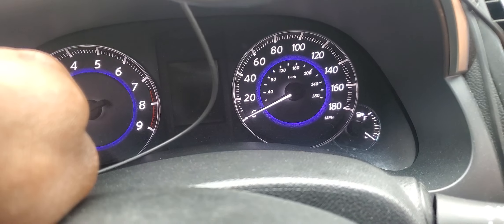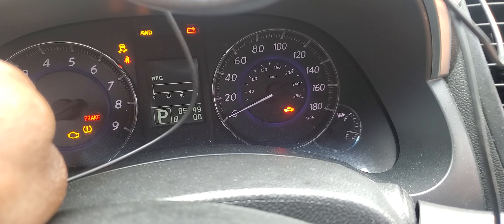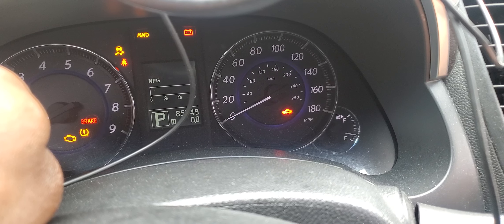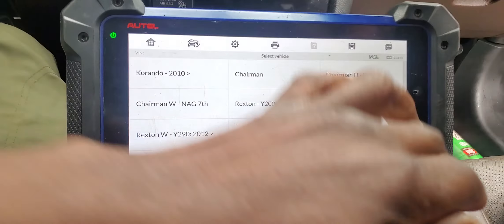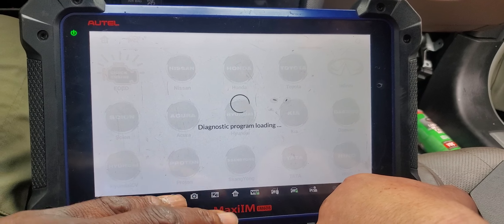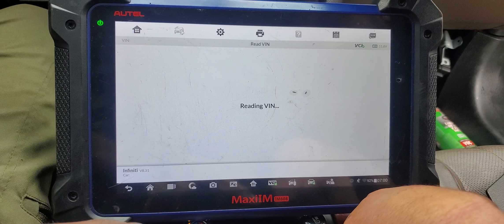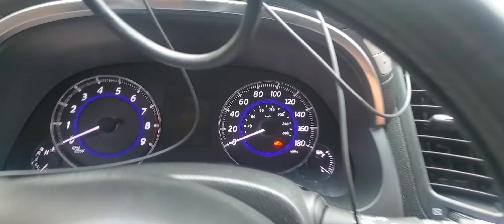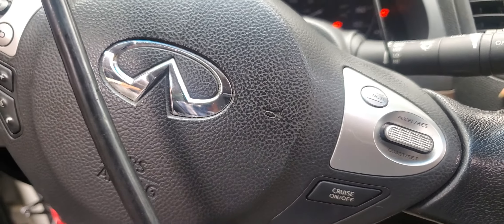I just want to try it — sometimes it stops. Let me push it. If the fan doesn't go on, it stops. We have no communication — that's the problem. Right now, the fan is not on. See if we have communication. It takes too long — it's not going to read. So let's see why — the fan should come on unless the communication line is down, or there is a power/ground issue on the fan. I think the computer got fried — they boosted the car, maybe they put the signal wrong. Everything is possible.